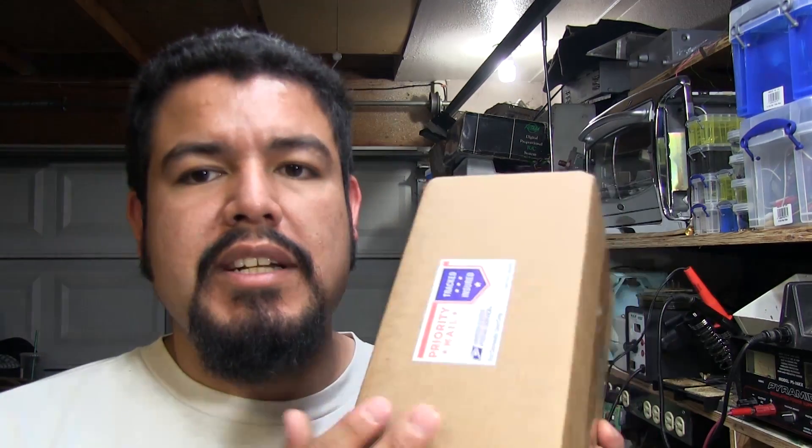Instead, my friend wanted full six individual injector outputs. The only way to do six individual outputs was to upgrade to a Megasquirt 3, and that's what I have in this box that I just received in the mail today. The MS3 has eight injector outputs and eight ignition outputs, so we can drive up to eight ignition coils and eight injectors all sequentially, each one individually. With the MS-2 here, we'd only be able to drive all the ignition coils with one output because he's not using a distributor — he's using coil packs. So I'm going to open up this box and show you guys what the MS-3 kit consists of.